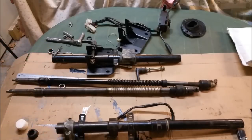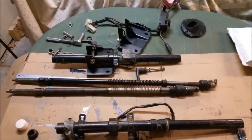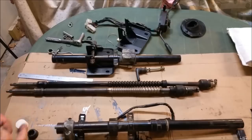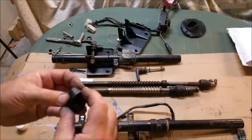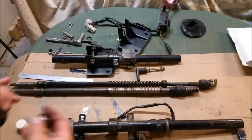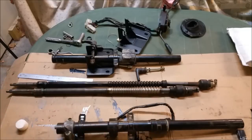We are going to use the original GH one. This one has an encased needle roller for the end of the shaft - there's a longer one, and the bearing is pretty well flogged, feels very loose on there, encased in a rubber sleeve. The rubber is soft and will still allow a little bit of movement in the column, and that's not roadworthy. I haven't measured the slack exactly, but that's the problem we've got.